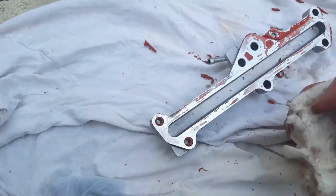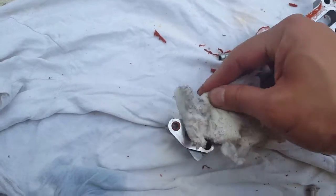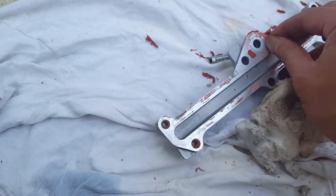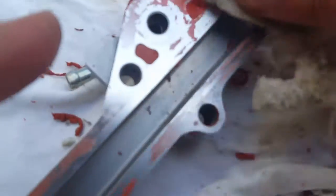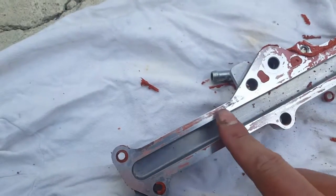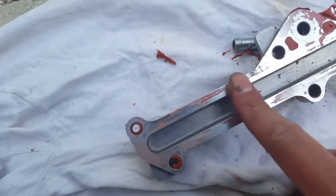What's happening is the melamine sponge is actually rubbing off all the silicone and it's not really doing much to the aluminum or the metal parts, but it's definitely rubbing off all the red gasket material — it's just the RTV silicone. I've already scraped off a lot of it using a razor, but the small fine stuff the melamine sponge just rubs off as if you're rubbing it off with your finger.